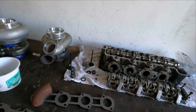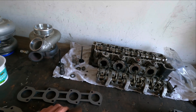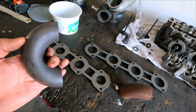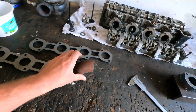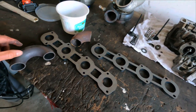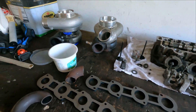The thing I decided is to redo the complete exhaust system - it's a lot of work of course. I want to show the difference: these are the flanges I'm now using. This is 36 millimeters, this is 39. This is one of the type of bands I'm using - this is 37 millimeters inner. And this is much bigger - this is 42 millimeters. So this is what I'm going to use. I can flow much more and I think it's the best way to do it, because I don't want any restrictions anymore in the exhaust system - I want to flow more than 500-600 horsepower.